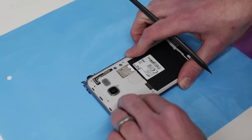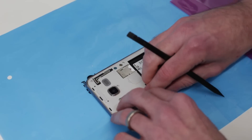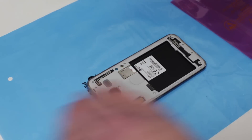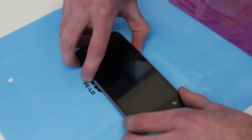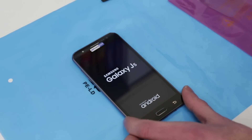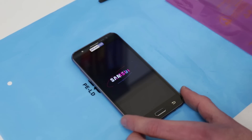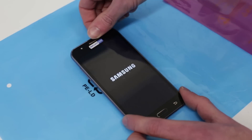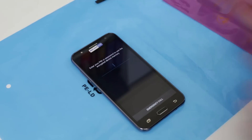There we go. Replace the battery and now we have our J5 with screen replaced. I hope you found this video useful. I did see a few guides online but I thought I could do something a bit better. And also it really isn't necessary to use the heat gun — you can heat this up enough to get the old screen off just using a wheat bag like that, rather than a full-on heat gun. Thanks for watching.